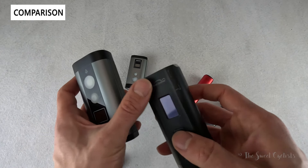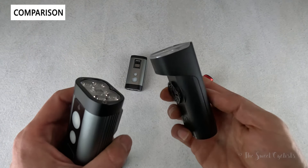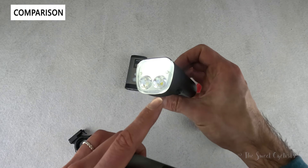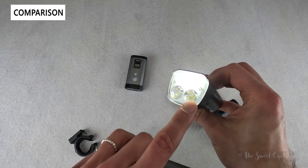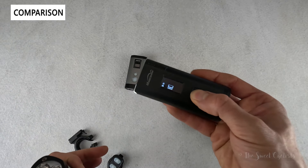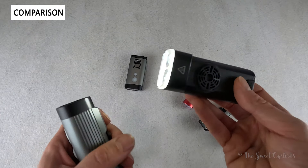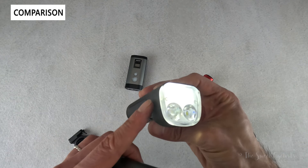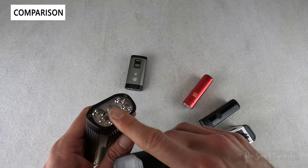Comparing to the Magicshine Ulti 2000, it also has an OLED display with white-on-black text and a dual beam setup, but instead of a focused center beam it uses more shrouding for a combination of centered and diffused output. The Magicshine has a more complicated single-press interface to cycle through everything, and features a cartridge battery that slides out and can be replaced — a nice advantage over the PR2400's integrated battery. The Magicshine also has DRLs for daytime use that consume very little battery, allowing hours of use rather than just a low mode.